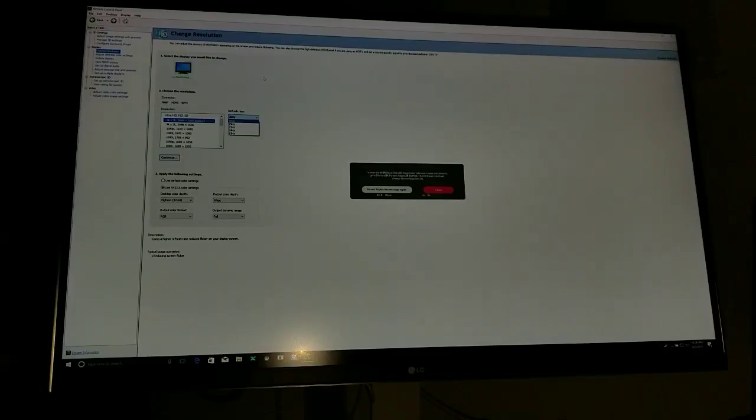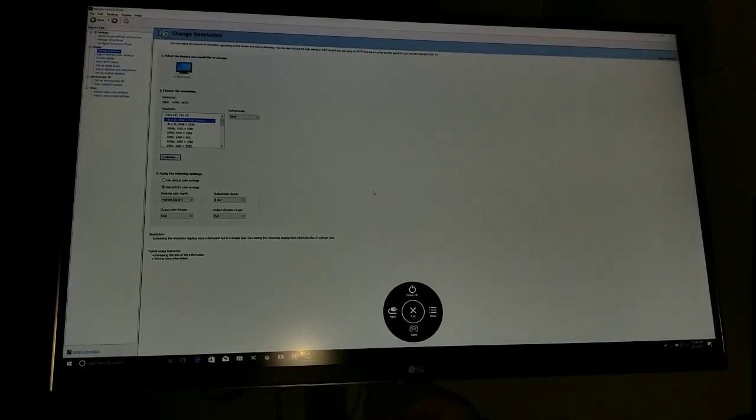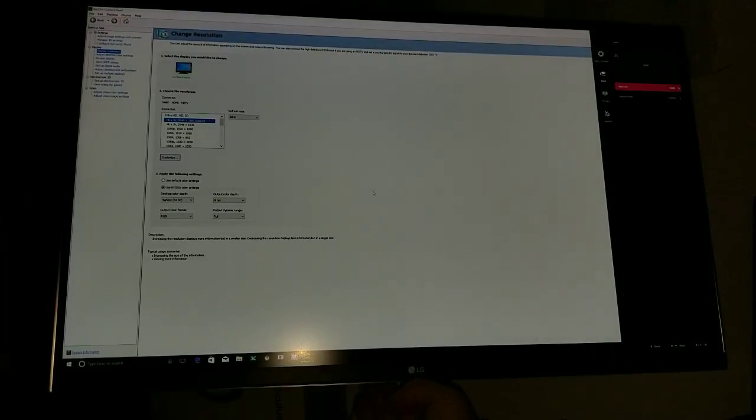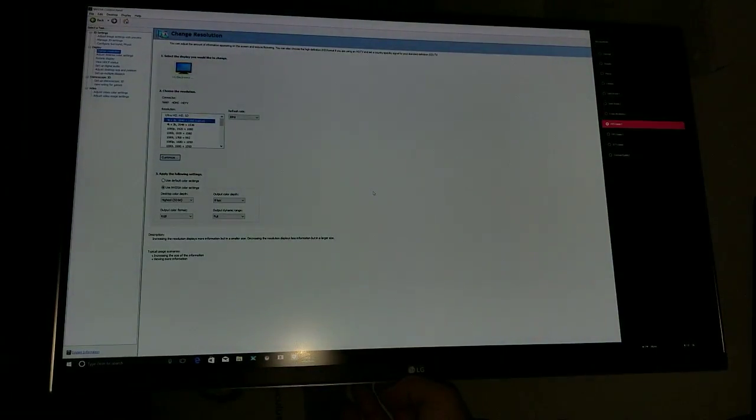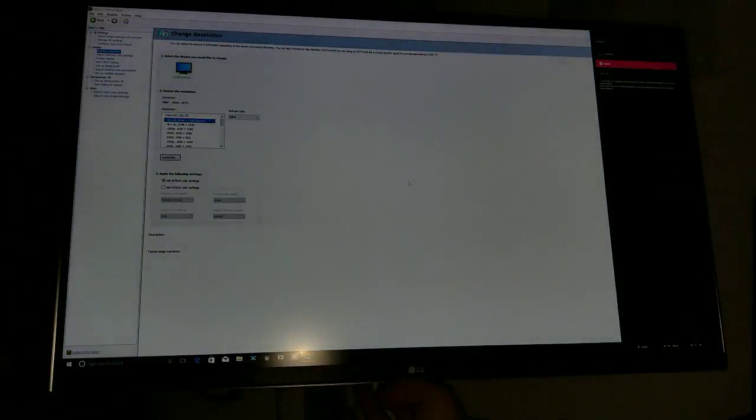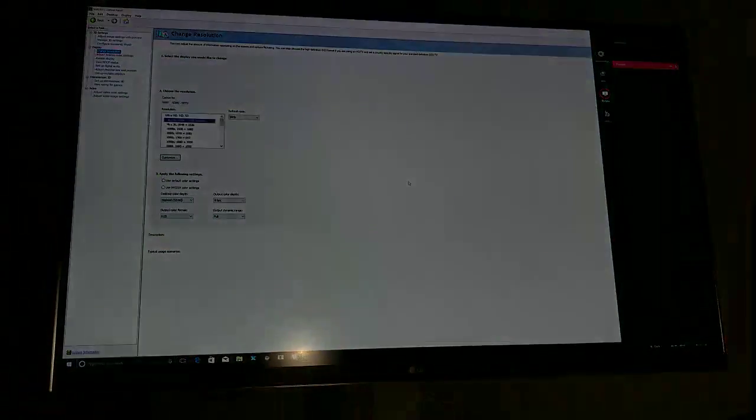For some reason it's not showing up. I don't know why. It's saying 30. To view 4K 60 Ultra HD Deep Color video via connected devices, go to Picture, Adjust HDMI Ultra Deep Color. You have to go to the picture. All right, let's go to the picture. Input, let's go to the menu. Let's go to the picture. Picture mode. Let's see, Darkroom Cinema. So picture mode, picture adjust. We'll turn the FreeSync on, why not? Actually, we'll turn that off. We don't need FreeSync because we don't have a FreeSync card, so we'll just turn that off.